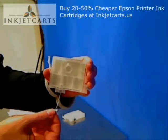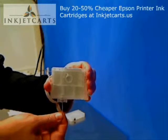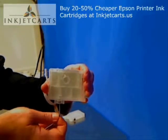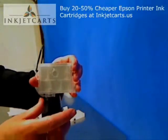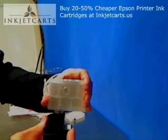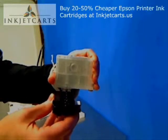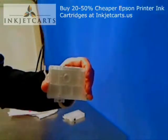There is a valve seal at the bottom of the cartridge. Never try to remove this plastic seal as it contains the valve seal that seals around the printhead shaft. Here is the printhead of a typical Epson printer — go ahead and install that cartridge onto that shaft. You can clearly see that the shaft is going to pass that plastic shipping seal, so never try to remove that — you could dislodge the seal.